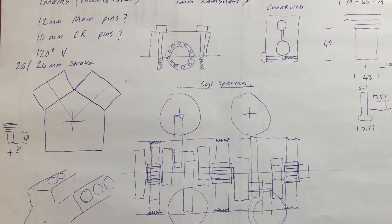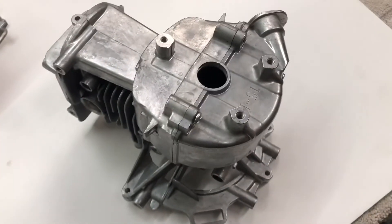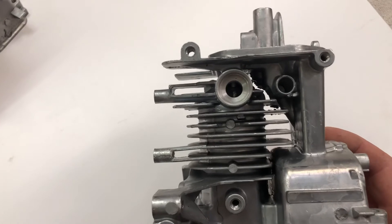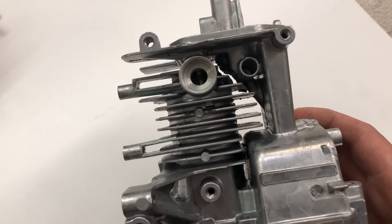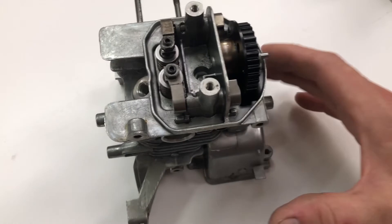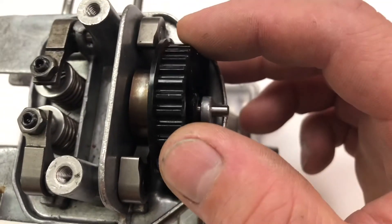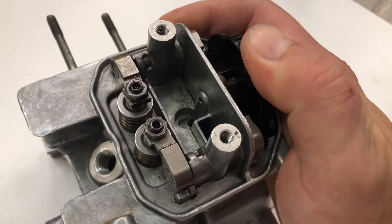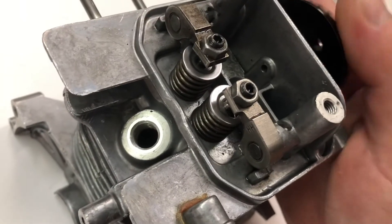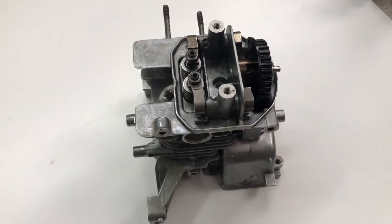After a few sketches I started going over to the engine. Even though the GX25 looks small, the valves are tiny and the cylinder is really small — all of the bulk makes it difficult for that repeatability that you need to make a compact engine. That's a barrel that's had the bottom taken off. You can see it's an overhead cam that uses this rocker finger arrangement, so as you turn the cam it makes the valves open, which seems to work quite well.